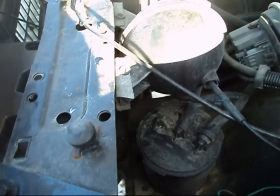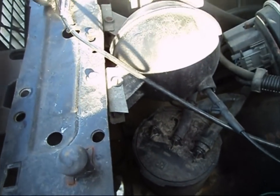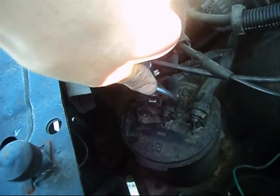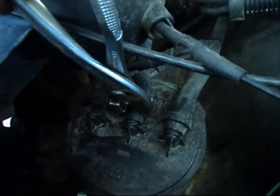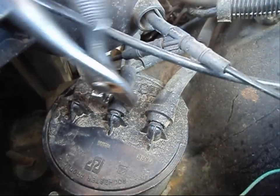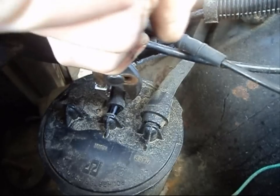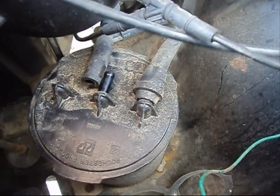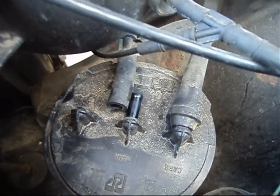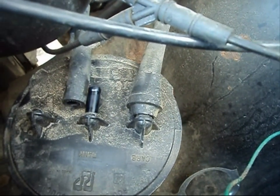Removal is very straightforward. Get yourself a pair of channel lock pliers or any pliers to remove the hoses - there's a good chance these hoses haven't been removed in quite some time. Grasp the hose with your pliers, move it around a bit to break off the grease and gunk, then pull it off. Take masking tape and label it - put a piece of masking tape around the hose and label 'T' for tank, and do the same for the other one, label 'C' for carb.